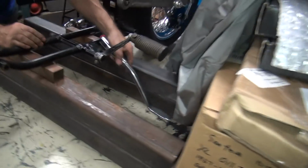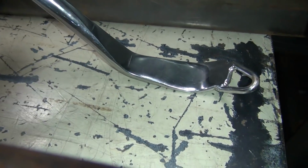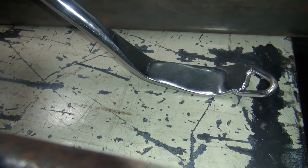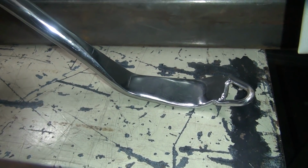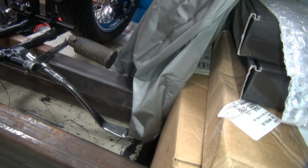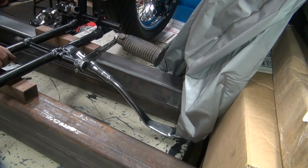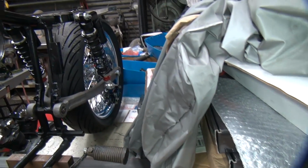That ought to be a good starting point. See, we're not quite enough. See how the bike won't stay leaned over? Why is that? Because the bike's too low. The kickstand's too low. So it needs to be bent back a little bit? Yeah, when we jack this up, the bike will lean over further. Okay. So right now it's made to be jacked up further.